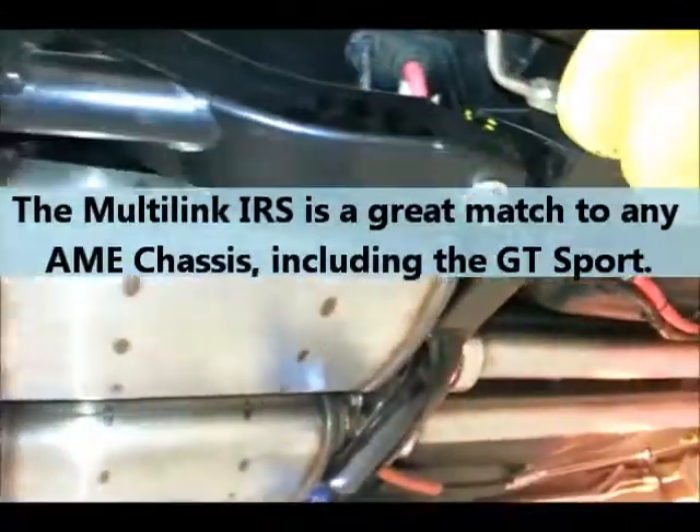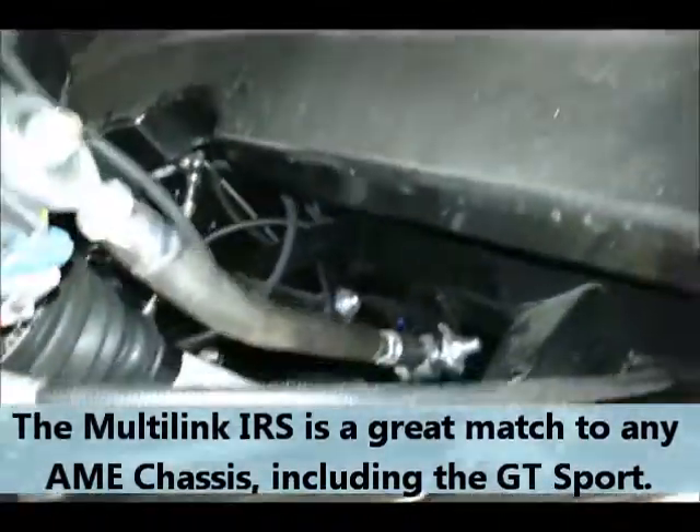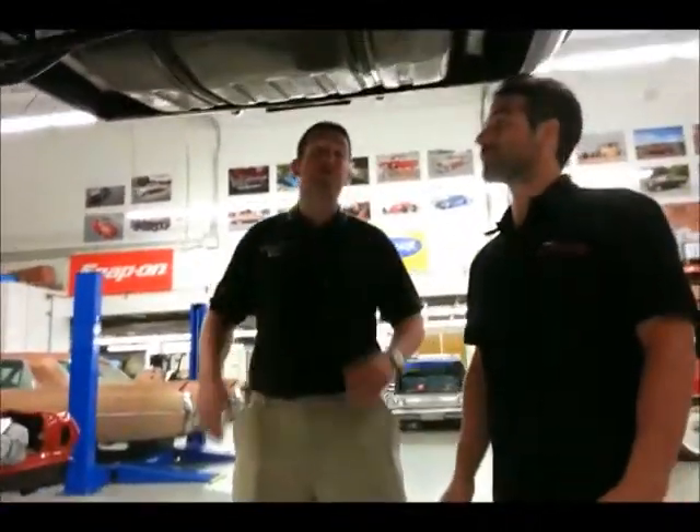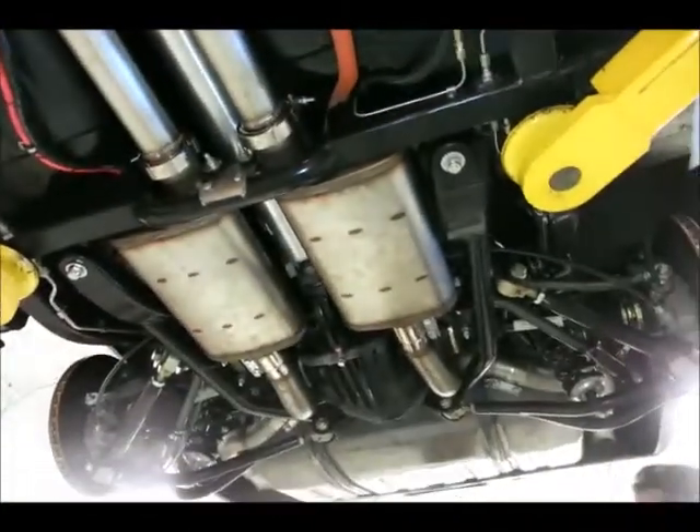These are the Morrison GT Sport rear clip. Would you recommend that as a necessity for an upgrade on this? For a guy who makes plenty of power, these rails are very, very strong. And for a Camaro, for instance, the stock rails are very thin, and I wouldn't feel comfortable attaching brackets to them.